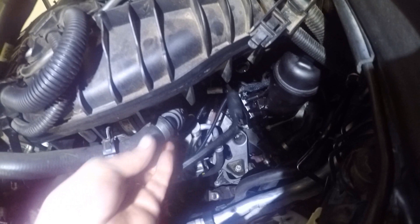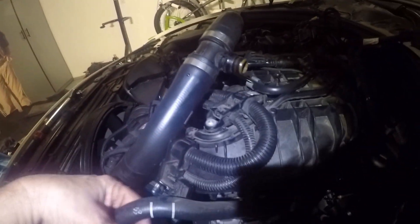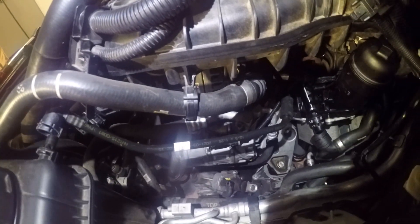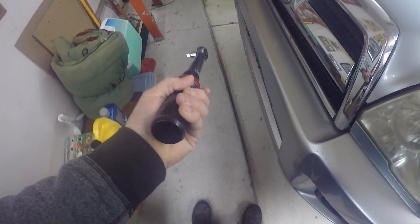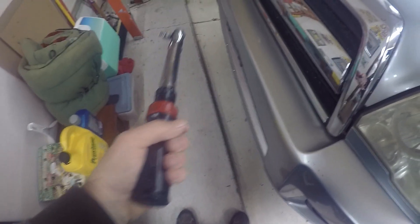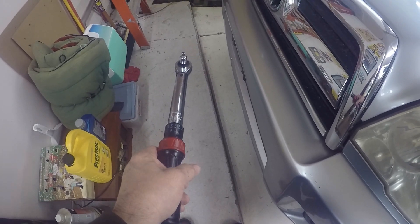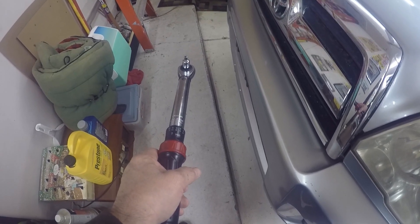Now we've got to start putting all these hoses back together. This hose here goes to this charge pipe. This hose that we got out of the way — we'll put this back underneath there and it goes down underneath right there. And then we've got some other hoses here that go to that, and we're just going to start putting that back together. This is the torque wrench that I used — it's rather large, inch-pounds and newton-meters, and I've got a three-eighths to quarter-inch adapter, so it's quite big. If you can get a smaller one to fit in there, the smaller the better — maybe you can get to that second bolt that you torque.